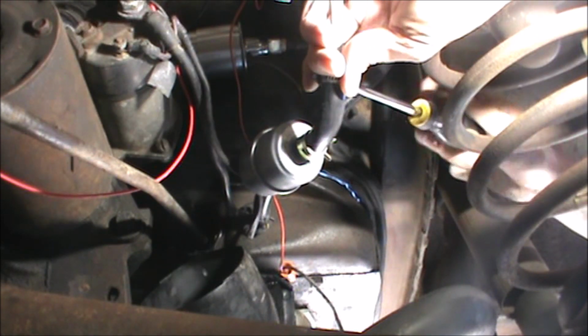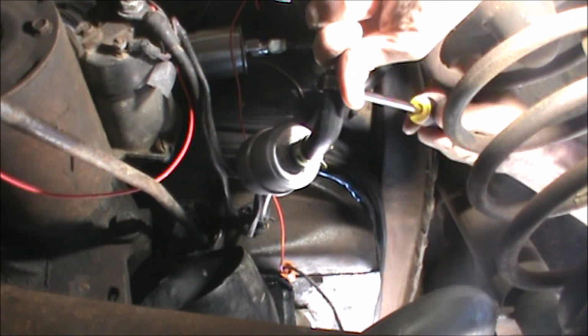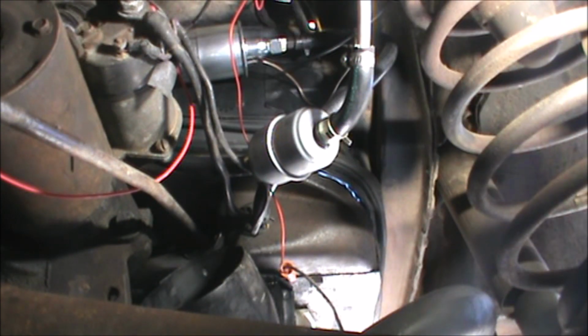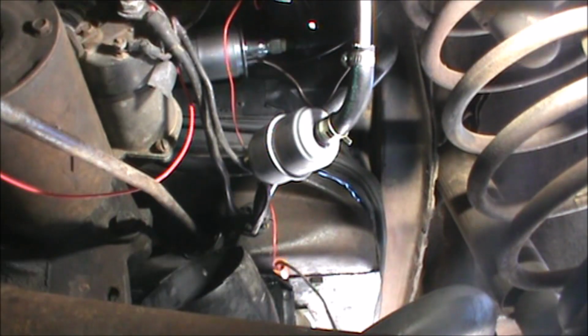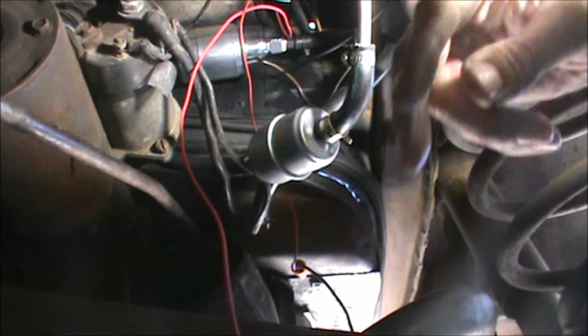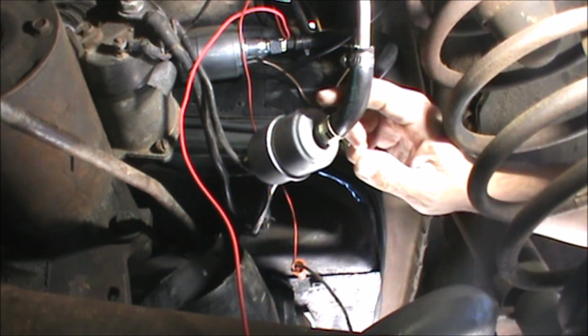All right, so we have a fuel filter and the pump. And this red wire here needs to go to a switched 12 volts. That is up in the front of the car, and that is going to be a nightmare. I at least do have a hole that the wire for the thermistor for the cylinder head temp gauge runs through. That goes down around here. So that's going to mean I have to take the seat out and do a whole lot. Let's see what time it is getting to be. 11:30. Oh, guys. That trip to Advance cost me a lot of time.